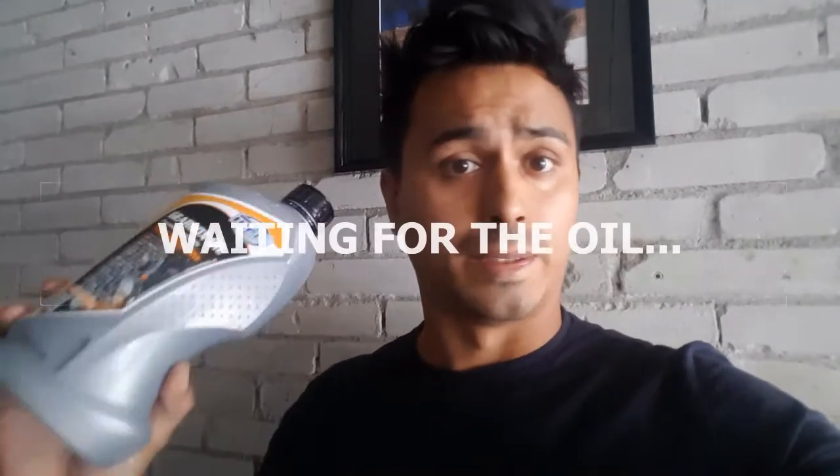Well, you don't need to measure up. When it's full, it's overflowing. I called the parts shop. There was a BMW expert there, and he said it's a little bit more than 1 liter. I have got some fluids out, so it's less than a liter. It's not overflowing. The guy from the parts shop has his girlfriend living over here, so he's going to bring a new bottle so I can fill the diff all the way up until it overflows, and then it's done.